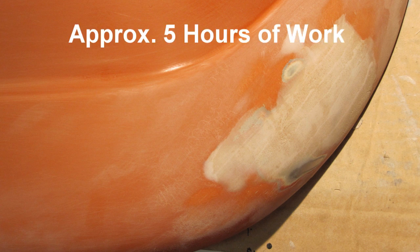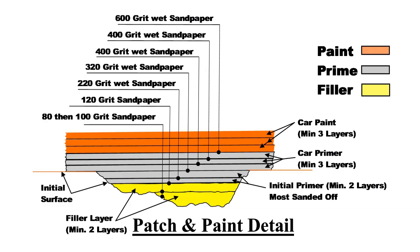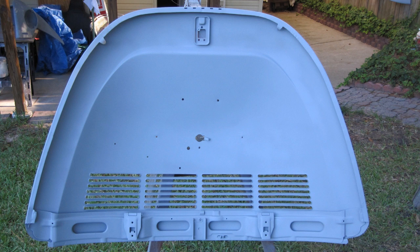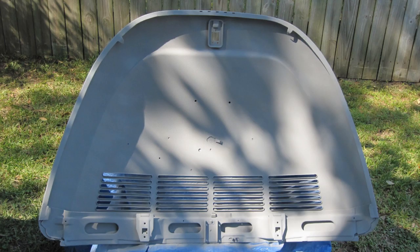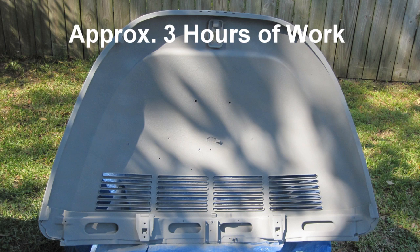Work on this section five hours. The same procedure shown in detail in the fender section is used for patching the dent, priming, and painting. After sanding each time, wash the deck lid down with water, let dry, then wipe with wax and grease remover using one rag and dry with another. Mix paint for painting the back side — work on this section about two hours. Back side of deck lid after the second coat of prime. After sanding and prepping, apply a third coat of prime on the back side — work on this section about three hours.